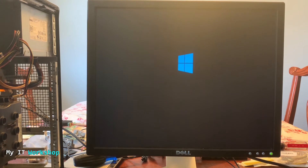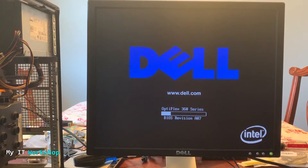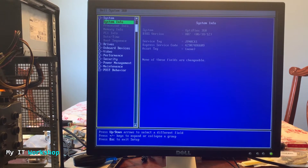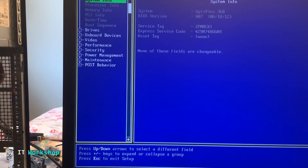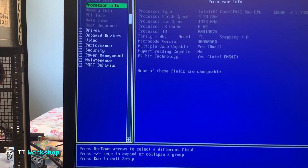The Blue Screen of Death reboots itself automatically — you just wait. After that I could see the Windows logo again, but it was stuck there. After waiting three minutes I rebooted one more time. This time I pressed F2 to access the BIOS. In the BIOS I can see the model — Optiplex 360 — and on the top right the processor clock speed and bus speed. The BIOS is detecting the new processor correctly, so that's not the problem.